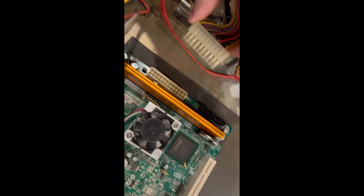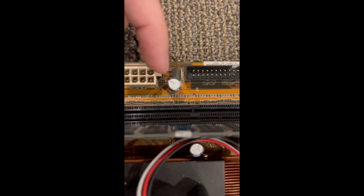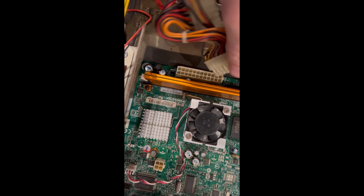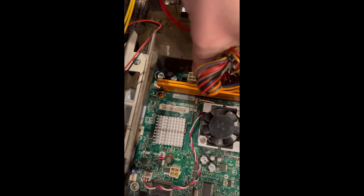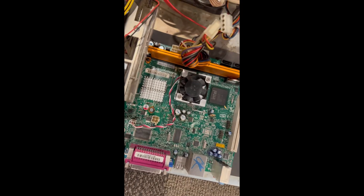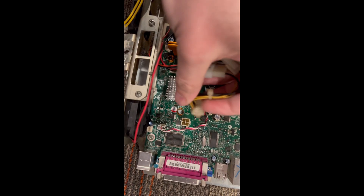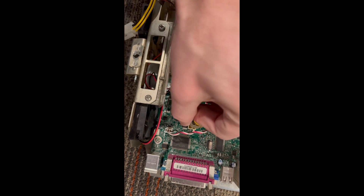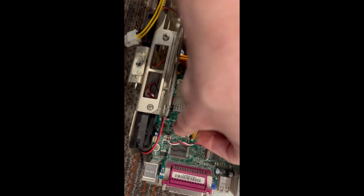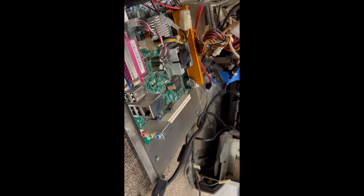For plugging these back in — when I removed this from the old board, these four pins here were not used, it was plugged into this side. If you look carefully, there's a number one here, so I'm going to match that up over here with the number one to start it off. I'm going to plug this in with number one starting there until it clicks. Then likewise there's the four-pin connector — this looks like a splitter for my fans — and that was going into this four-pin connector here. I'm going to take the VGA and plug it into the VGA, take the USB and plug it in, and then there's an audio cable that's going into the green connector.